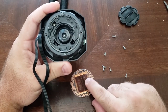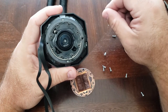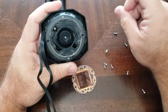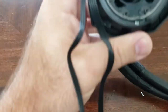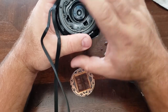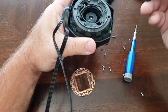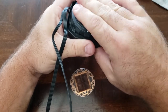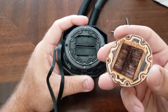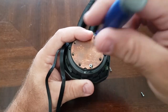You'll need something to prevent corrosion, especially because this is a copper piece and the radiator is aluminum — that is a mixed metal system. Pour everything directly into tube one or two, whichever you prefer. Keep it elevated above the radiator so it doesn't get any air in it; shake the radiator around. Once it's entirely filled, put your gasket back on — overfilling is fine because the more you overfill, the less likely you are to get air in it. Then put the cap back on and put the screws back in.